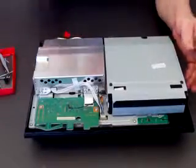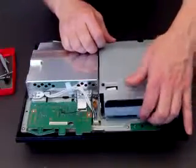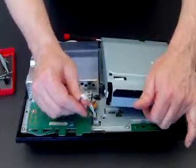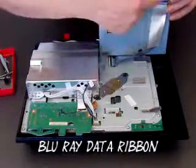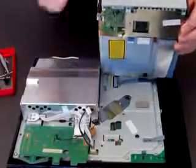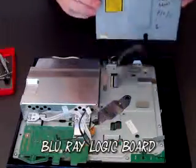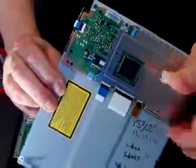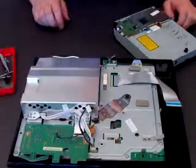The first thing we'll do is remove the Blu-ray, and that's done simply by gently lifting it at the front and taking out the power cable. Then if you lift it a bit further you'll see your data ribbon. The little clips at either side connect from the main board to the Blu-ray — this is the logic board here. The data ribbon goes into the logic board, there's a little clip, and you just clip it off. You can see the clip there — that's where it clipped into.